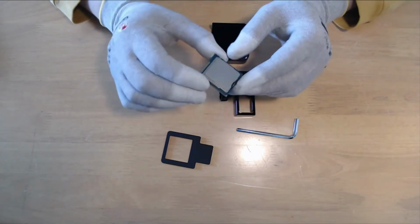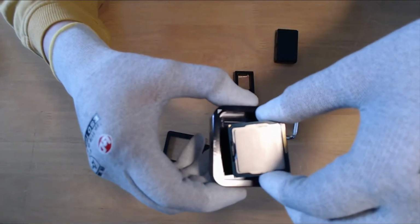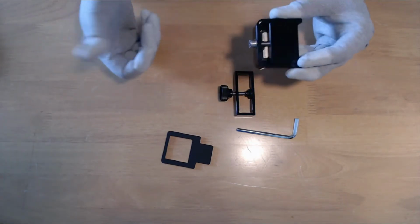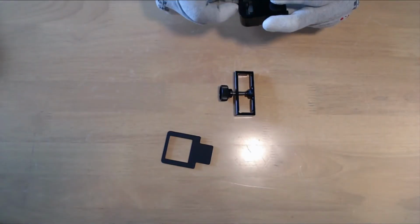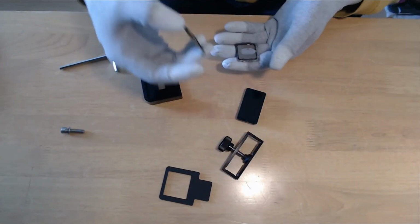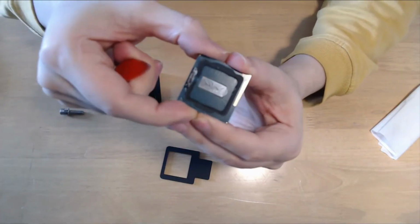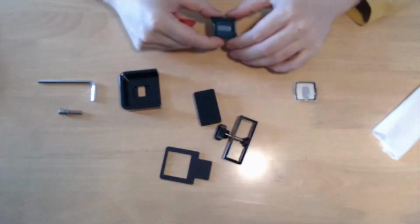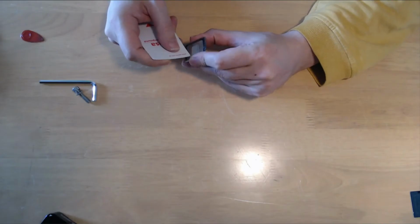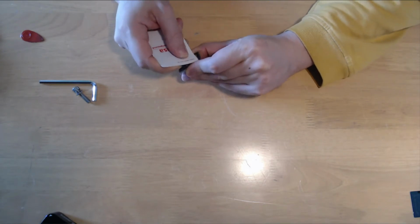First, you align the processor inside the delid tool, using the CPU's golden triangle corner as a guide. Then, slot in the slider, attach it to the screw, and use the hex wrench to turn the screw until the IHS pops off. Now remove the soft plastic, and then, with the use of alcohol and a napkin, remove the old thermal paste from the die, and then remove also the silicone adhesive from the edges, being careful not to scratch or damage the chipset or the electronic component contacts around it. Do the same to the IHS and remove the paste and the silicone without scratching the metal.